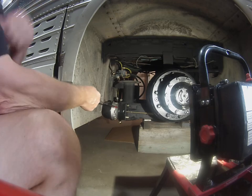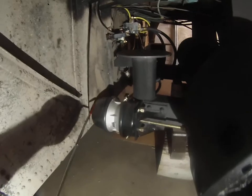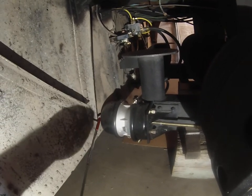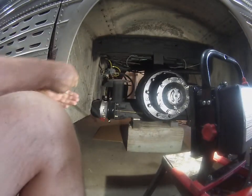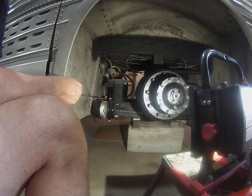As you can see it's a tight fit — you have to figure out how much room you want to leave between the brake can and the bulkhead. I left about three quarters of an inch in there, that's just a clearance thing. Theoretically there's no way that your axle can go front to back; the axle just goes up and down, it does not ever twist, so there's really no way the can can hit the bulkhead.